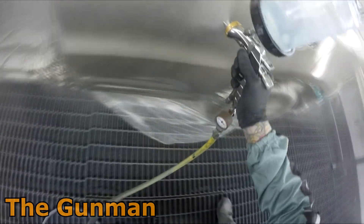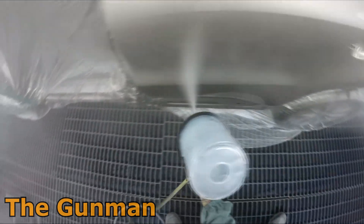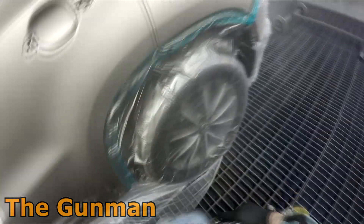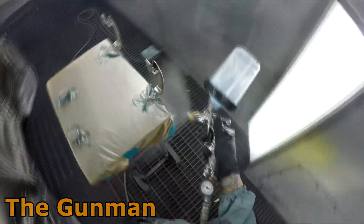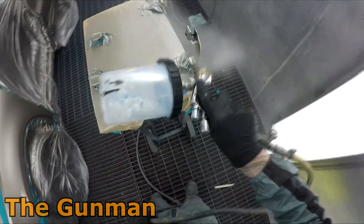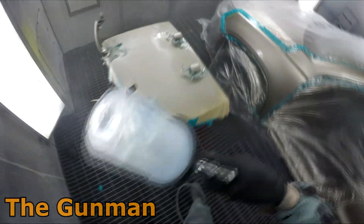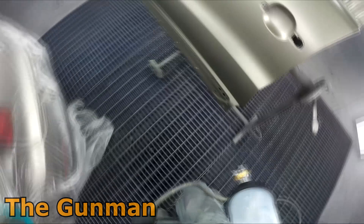I've been using my Pro-Lite TE20 with this clear coat and the 1.3mm. The other painter said this LS400 is one of his favourite clear guns - he's using the LS400 with the number one air cap, which is the HVLP cap, and I'm really impressed with it. I was speaking to the guys from Spray Guns Direct about getting one myself and they said over here it's actually more known as a base coat gun for HVLP guns. Only really good painters can get decent finishes with them - otherwise you'll get a big orange peel. I probably wouldn't recommend a HVLP gun for MS clears.